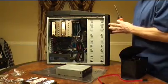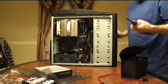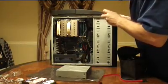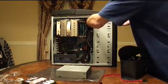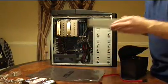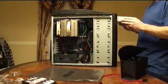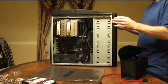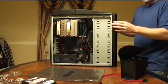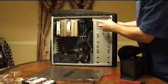To prep your case, you need to pop one of these front panels off. That's just a matter, depending on your case, of either snapping it out or undoing a couple of screws. It comes off, the drive slides in — don't force it, it will go on its own if it can. Slide it in and line it up at the front of your panel. It comes with mounting screws that will then fit in your case.